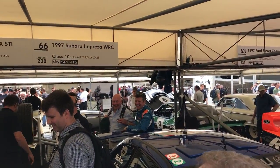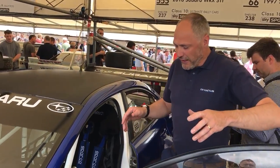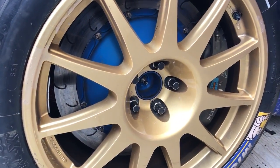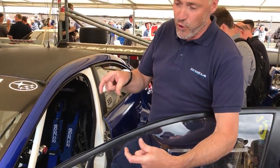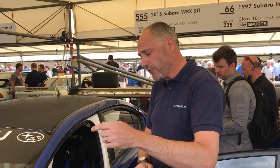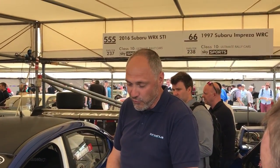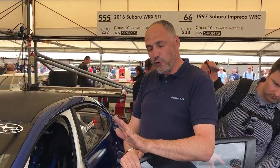There's always a driver element to it - yeah, we can always find points where he's lifting off the gas. From a suspension and brake perspective, it's back to our old WRC heritage. We've got 380mm discs and eight-piston calipers. We'd normally have water cooling on the car for the World Rally Championship but you just don't need that for the TT or Goodwood Festival of Speed. Eight-piston calipers with four pads per caliper - the four pads per caliper are important because a big long pad can suffer knock-off with a long brake pedal; any high lateral loads push the pistons back so the next brake application gives a long pedal. So you want to avoid that. A very big wheel bearing, inherently stiff upright, and that brake arrangement gives a nice feel and a responsive brake pedal.